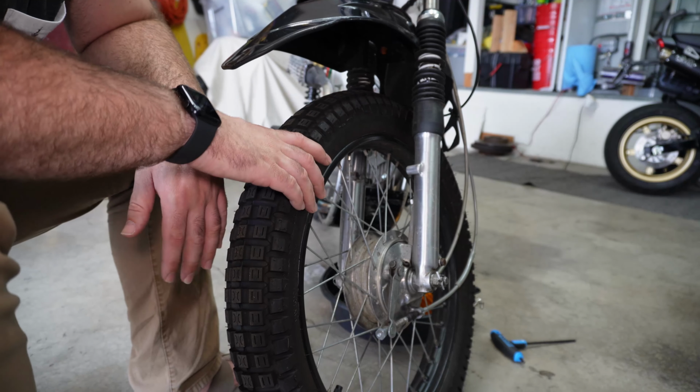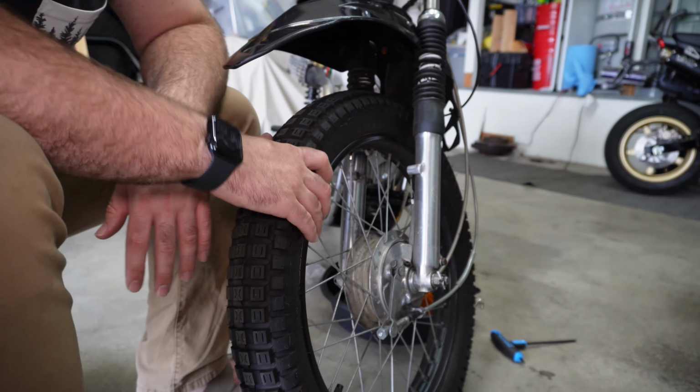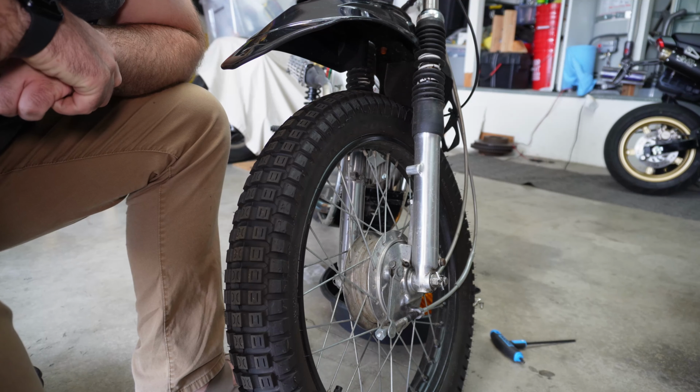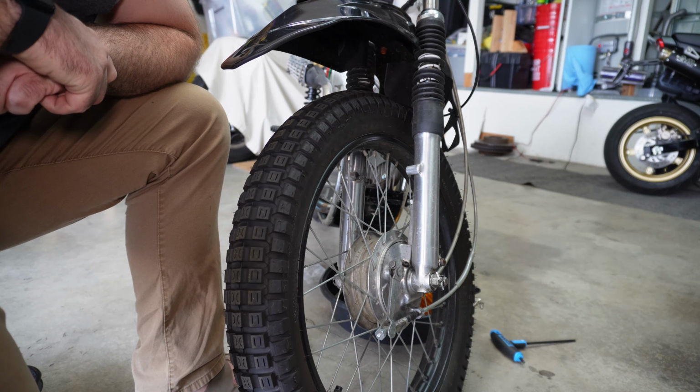The only thing I had to do to make it match up is there's a little aluminum bar right here that I had to shave to fit into that stay, but it works really well. They are drum brakes, but I can lock up front and rear no problem, and haven't had to touch them since I installed everything, so that's been nice at least.